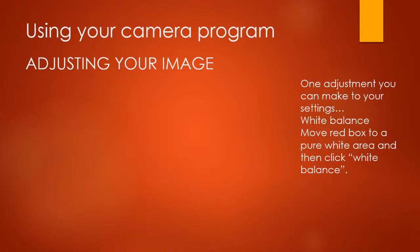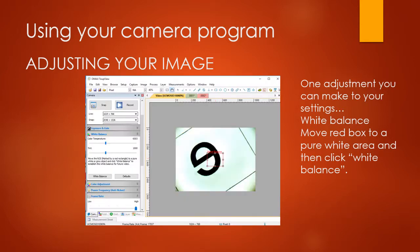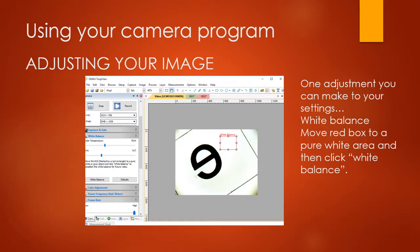There's an adjustment you can make to make your image a little bit clearer. On the left side of the screen are different settings. If you click on White Balance, a small red box labeled White Balance will pop up. Move that box over to a clear or white spot on your screen, then click White Balance — it will make the white areas really white instead of having a grayish look. That's not something you have to do right away, but it's a useful adjustment for getting a clearer, better image.